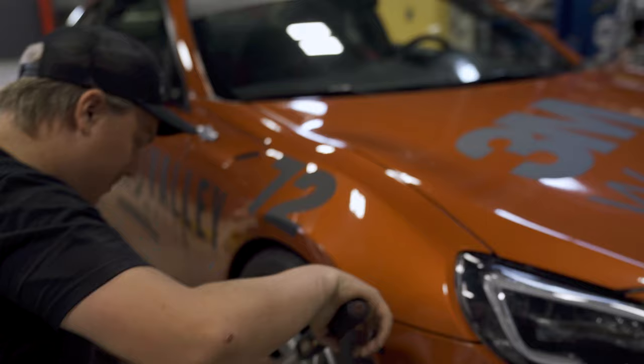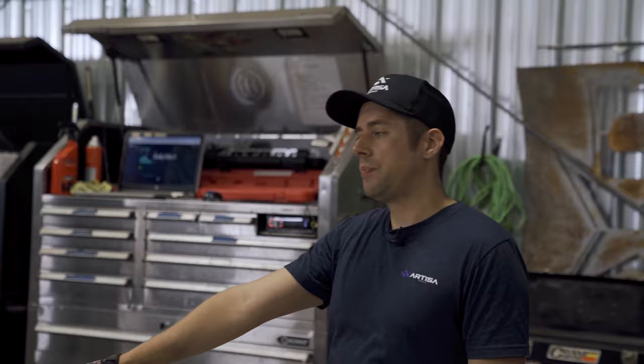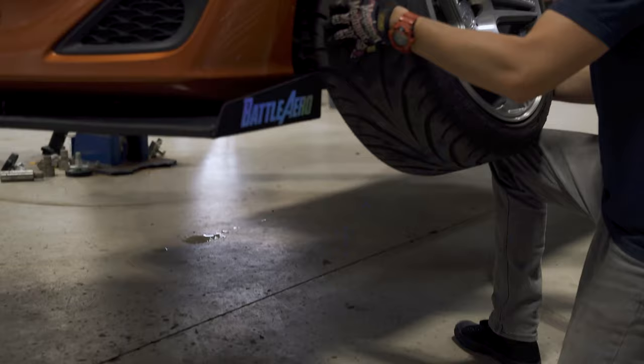Make sure you're doing that star pattern. Here's another pro tip: check your torque settings after you put your wheels on. If you drive like 100 miles or whatever, just go back and recheck the torque settings. It doesn't hurt — you don't want a wheel coming off on the highway. Ain't cool.